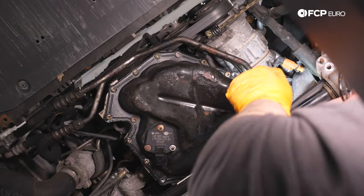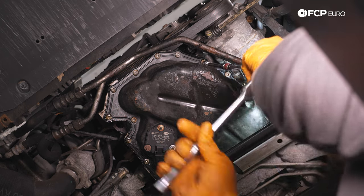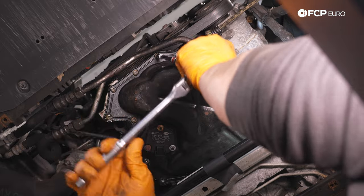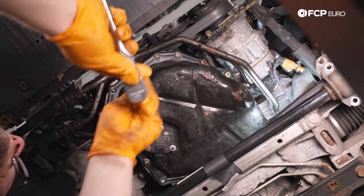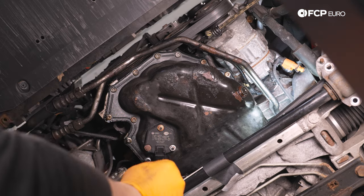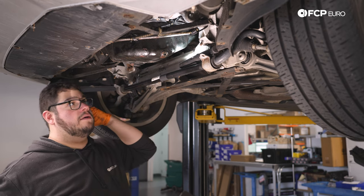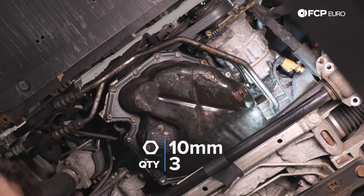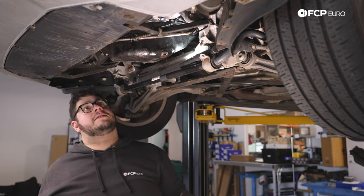For this next one, going towards the front on the driver's side, we're going to go with a quarter-inch ratchet and a regular T30. We have just enough room — the flex head is a must for doing this job. It'll allow us to get on the bolt properly and have somewhere to swing the ratchet to break it free. Now all the easy ones we can get to no problem — we're just going to work on breaking them all free. Then we will go around with the electric impact and zap them out after we get our oil sensor out. It's nice to start with the pain-in-the-butt ones so you can reward yourself by doing the easy ones last.